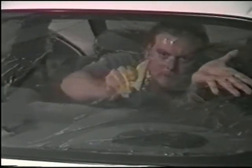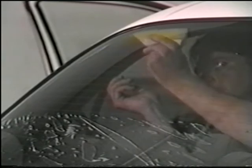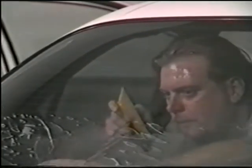When squeegeeing the water out from the film again, start at the center and work from top to bottom and left to right. Divide the window into quarters, just like you did in the pattern preparation. Always make sure that your squeegee technique is exactly the same as the shrinking preparation. The film should lie down with ease.